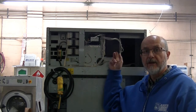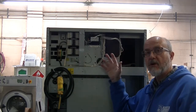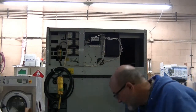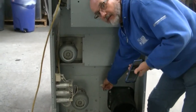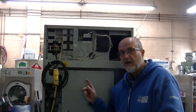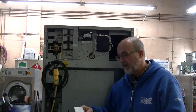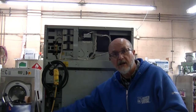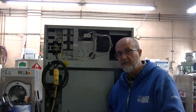This is the IO board on this machine and you can see all of the wires that come in here. This particular machine is showing the IO code overheat thermostat. What I've done is I've just disconnected my high limit down here. But what you really need to do to ascertain if this is the issue, you need to follow your circuit diagram with a multimeter. Here's the diagram here for this particular machine. We'll show you circuit diagrams as well and how to find the circuit diagram numbers — and if the diagram is not with the machine, you've got to use your multimeter and figure it out.